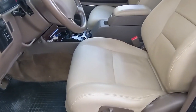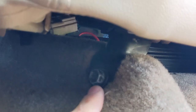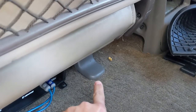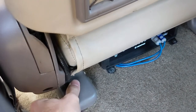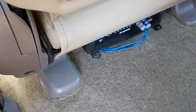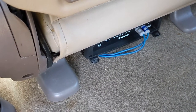The first thing we want to do is unbolt the seat and get it ready to remove from the truck. You're going to have two bolts down here in the front — one right there and one right here. You're going to have two bolts in the back, and one of them is under this cover and one is under that cover. These covers pop up pretty easily — sometimes you can get your finger under there and snap them up by hand, or just grab a little screwdriver and pop them up. Those are going to be 14mm head bolts on the front and the back.